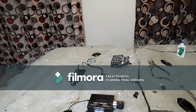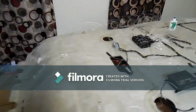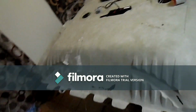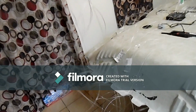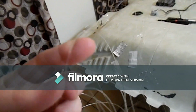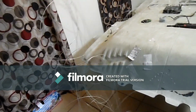You can do it. It's just very time consuming, and also I didn't think it was going to happen, but you are going to get tangled. You have to be patient, because if you pull it, you can bend the fiber. Once the fiber is bent, it's no good. You have to cut that area out. So you have to be very careful when untangling these things.